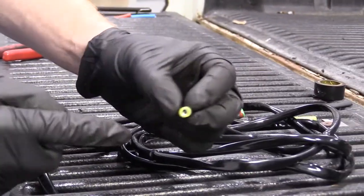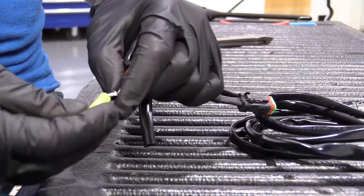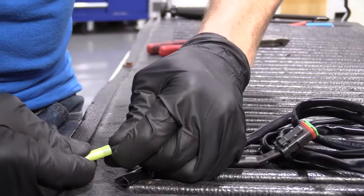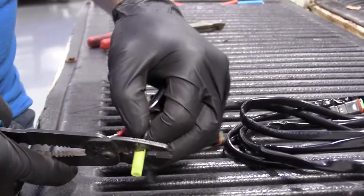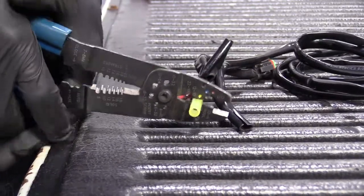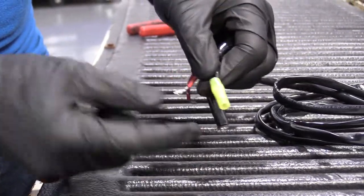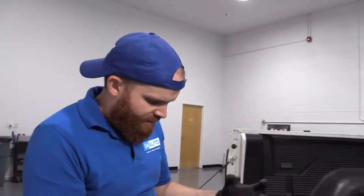Let's try something a little different — we'll go with one of these instead. Put the wires inside; they may need to be a little shorter. This just presses inside here — twist as you push. It's important to make sure you've got a little bit of metal coming up past where your crimpers will be. Crimp it down and give it a nice little tug. That's much better. You always want to tug it because a loose connection with your LEDs driving down the road means flickering lights.